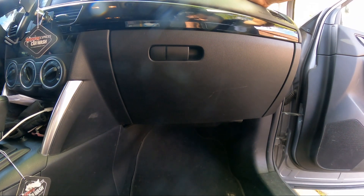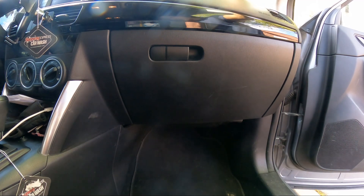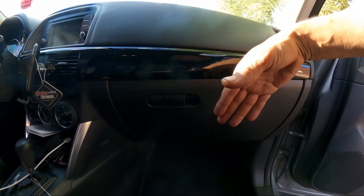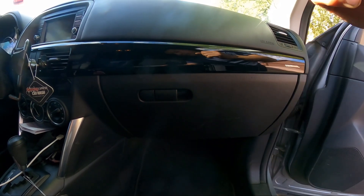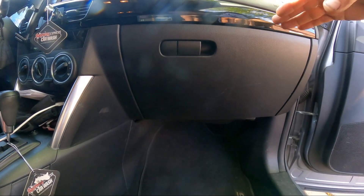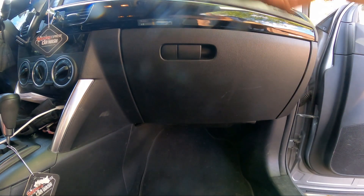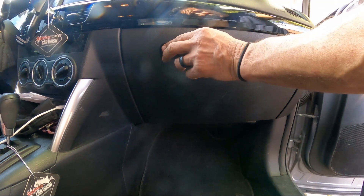Really quick — what the cabin filter does is filter the air coming from the outside. It's going to come from the outside, go through the filter, remove particles of dust, dirt, leaves, and whatever else, and those stay there. Then the filtered air goes through the blower motor and gets pushed through your evaporator or heater core depending on what setting the system is on at the moment. So it's very, very important.